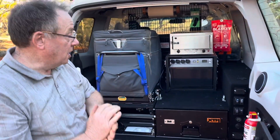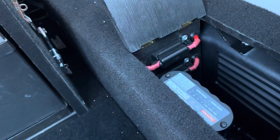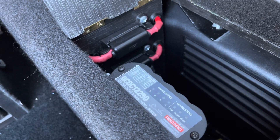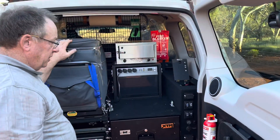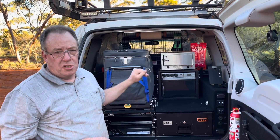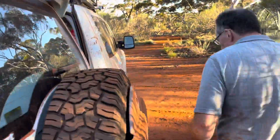One of the important things with having a spare battery on board is how do you keep it charged. I've invested in a Red Arc DC-DC — specifically the BCDC 1225 — which has capacity for solar input as well as alternator or vehicle input. It's all tucked away neatly, and I'm always big on safety with electrical work — you can see the two fuses there. The good thing about this unit is it runs on what they call green power priority: if your solar panel is pushing out current, the BCDC will take that and use it to charge your battery and take the load off your vehicle alternator.